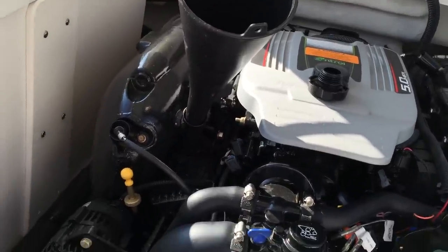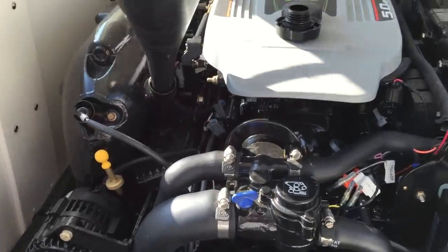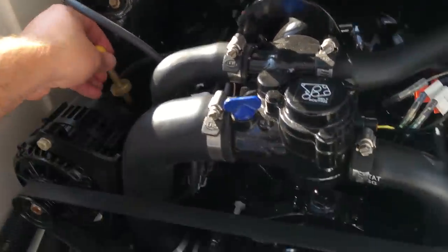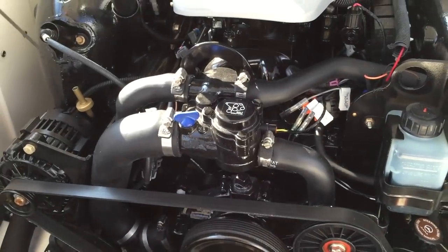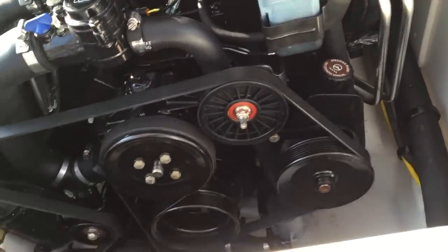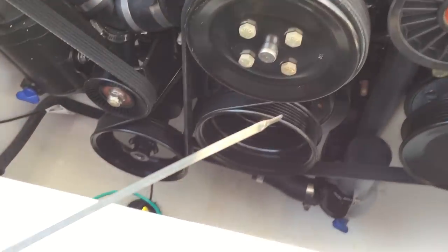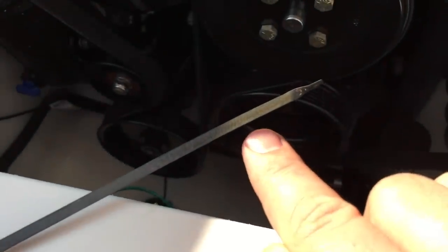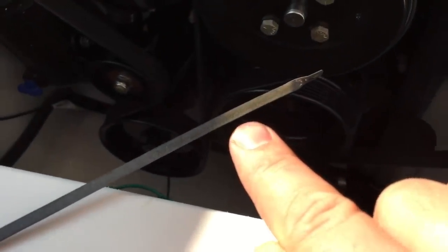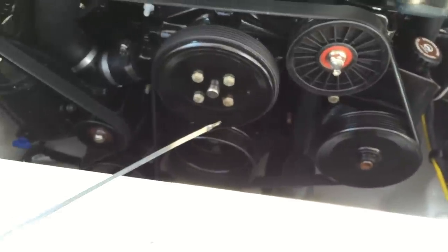Alright, we just added some more oil. We're going to pull our dipstick again and check now to see where our levels are. We may check a time or two — check it now, let it sit for a while again, then recheck, then check after running out in the water to see what our accurate readings are. Keeping that pointed down — it's hard to see, but the oil is about right up in here towards that upper range. This boat is sitting slightly back, so I'm going to leave it there for now and check it again once I get it in the water, run it around, pull it back on some level ground, and go from there.